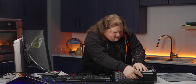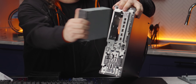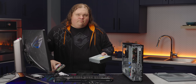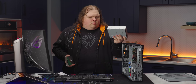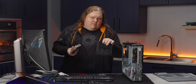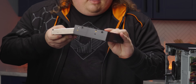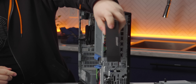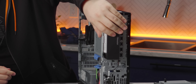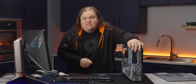This optical drive now serves no purpose. Removing it frees up some room and a SATA connection. But there's another problem: the optical drive bay is a different size than a 3.5-inch hard drive. So that's where an adapter bracket comes in — this will accept a 3.5-inch drive and slot into the optical bay. Obviously we need to actually mount it first, but that's the plan.